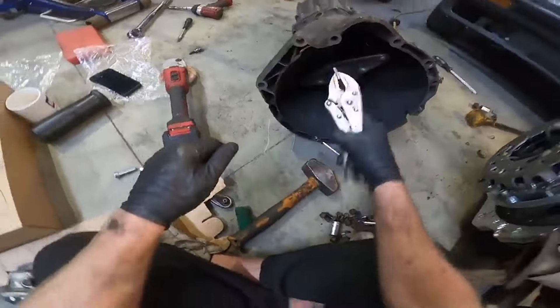With the engine mounted and the wiring in the car, it was time to give the engine some fuel. The car didn't actually come with fuel tanks, so this was a good opportunity to future-proof it. We went with a fuel cell with a lift pump and a swirl pot with twin pumps — whatever we did with the car, this setup would be good enough. We also got an E46 purple tag steering rack, which is a much faster rack than the standard E30 item.